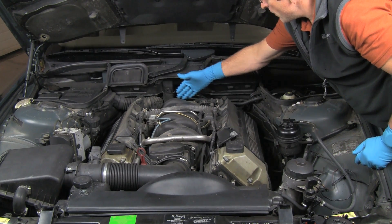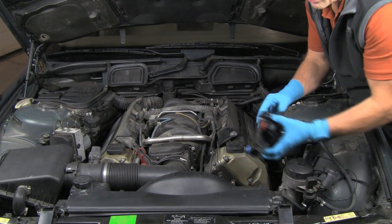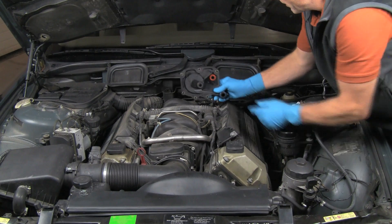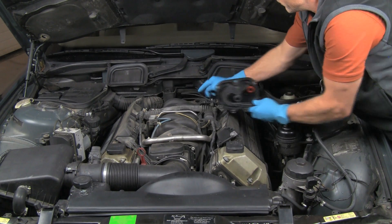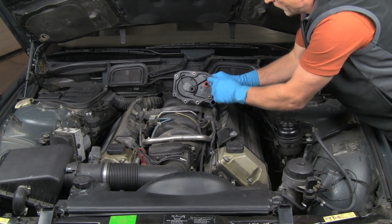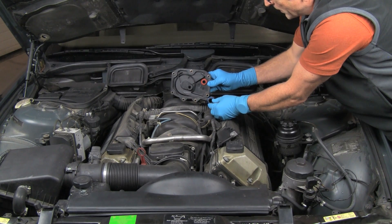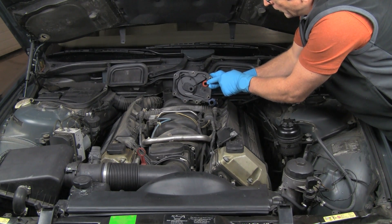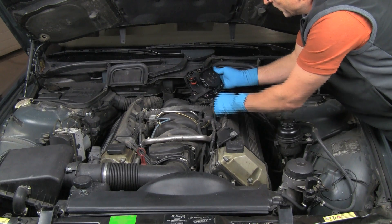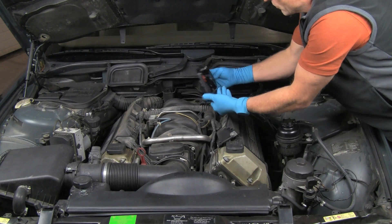Now we're working right here. I can put my hand on the cover — it's positioned on the back of the engine. The top is right here. So we'll be removing seven bolts. We've got an O-ring to a tube connection down beside the bottom of the manifold. Inside the manifold we've got a tube that connects here and here. We also have hoses here and here, so we'll be taking care of all those connections, plus some other vacuum connections as well.